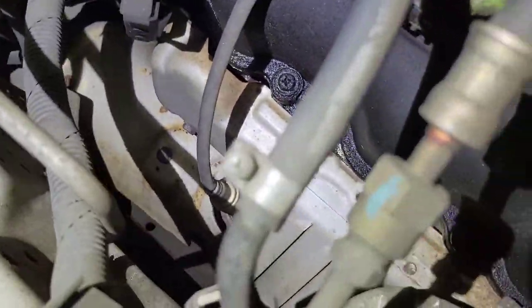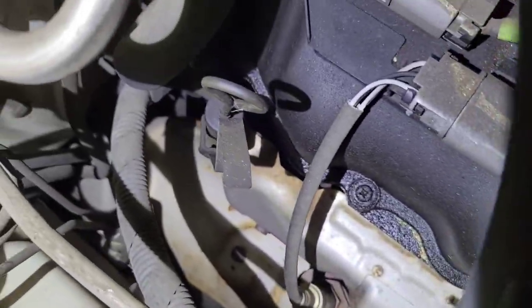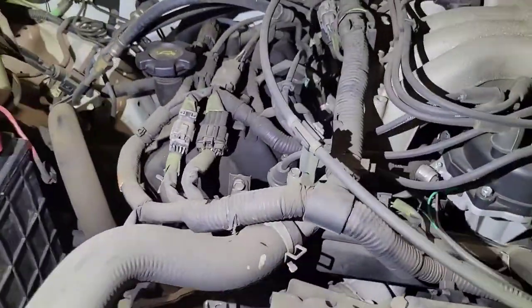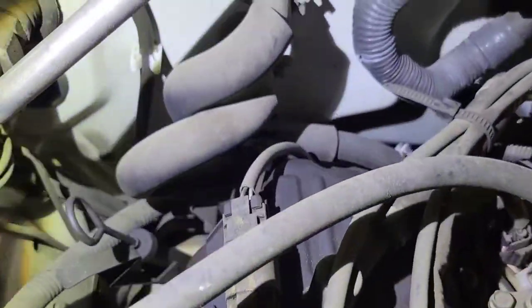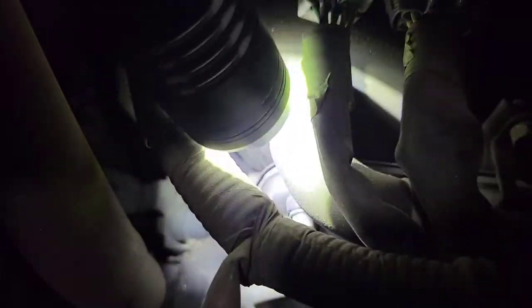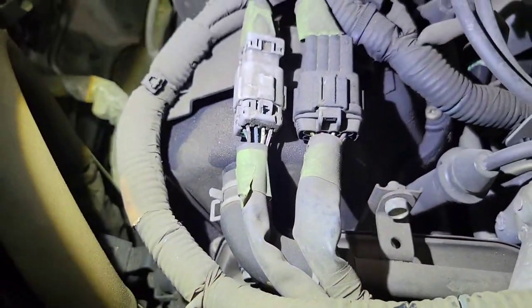You can see what it looks like — it's all caked on underneath, the exhaust is really bad, the cat and stuff like that. Usually people will complain of smoking; this one had smoke from under the hood because the oil is leaking down onto the exhaust. Usually these Phillips bolts are so loose from leaking that you can just take them out with your hands.